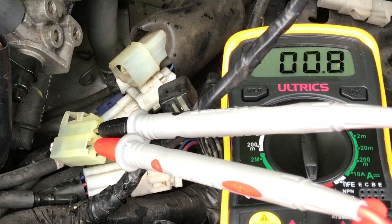Let's test each combination. First reading: 19–20 volts. Next one: close to 20 as well. Third one: close to 20 as well. Also be aware that the longer you run the bike with those wires unplugged, the quicker you'll be killing your battery, so get in and get out — do it quickly.